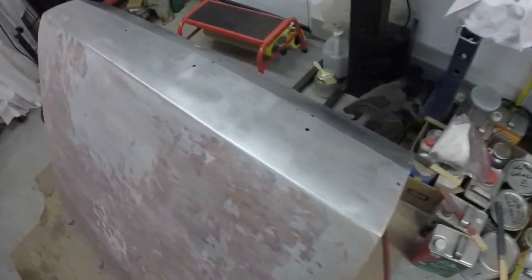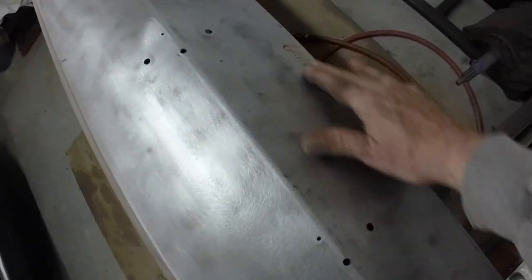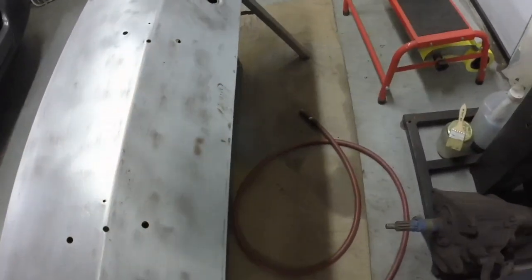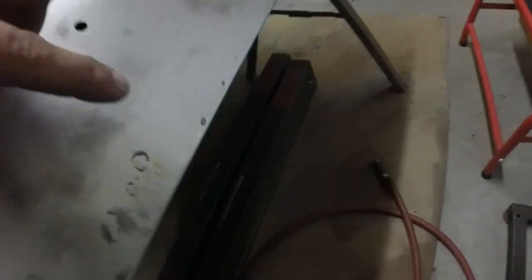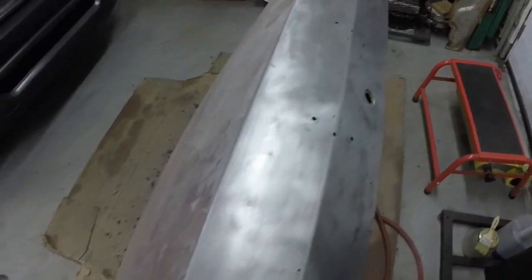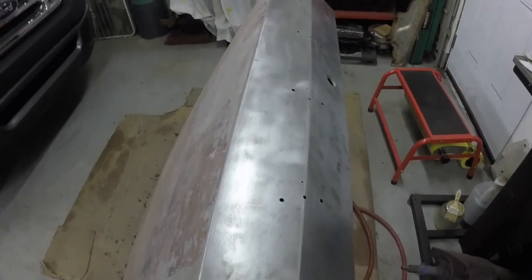Just more boring sanding happening, so that's why there isn't much video. It's been really nasty weather so I haven't been able to work outside. I got this surface sanded out. A couple little spots need filler where it's warped, and that's where I did some welding. You can see the little spot welds from the factory, full length of the trunk lid. They weren't all about perfection, show-car quality, but we're going to clean this up and make it look really pretty.